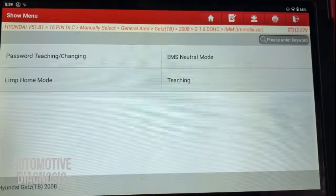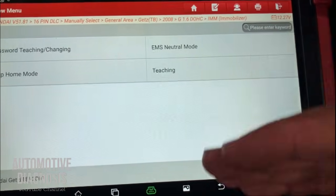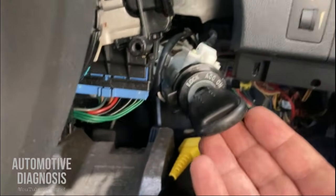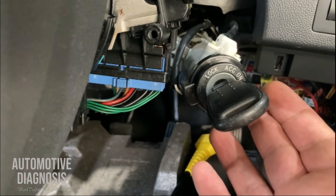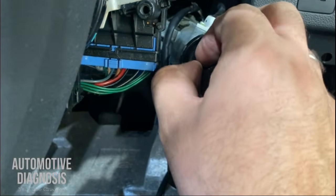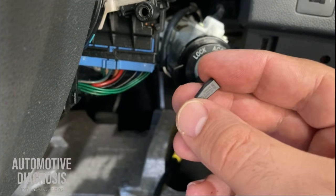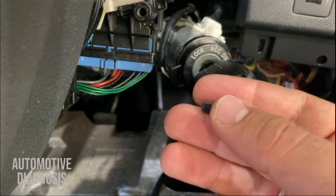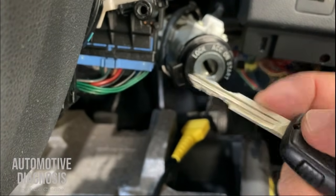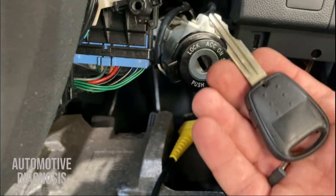There could be some differences on different cars for reprogramming keys, but most of the time you can do it with a scan tool and all the instructions are inside the tool. The most important things were to understand the components of the immobilizer system, what happens if any of them is faulty, and the importance of the transponder chip. I don't suggest bypassing the immobilizer system — by doing that you disable the whole system and anyone who cuts a key like this can start and steal your car. Thank you very much for watching, I hope you found it helpful.